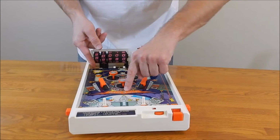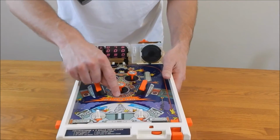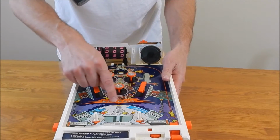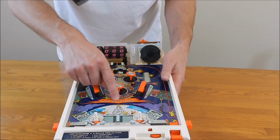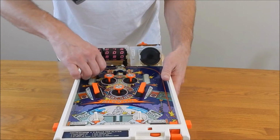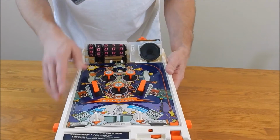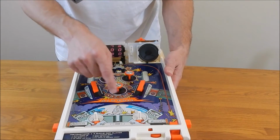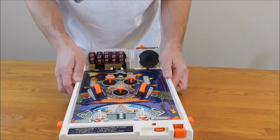There's a screw right here. I took it out because it's not a flathead screw, and the ball hits it and kind of disrupts the movement of the ball. So I picked up this tip to just leave it out. It's supposed to hold the metal plate in place, but it's not going to go anywhere with the glass cover on it when it's assembled. I prefer to have it out because for some dumb reason they didn't put a flathead screw in there.